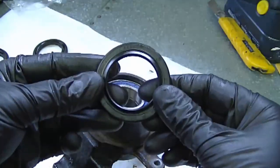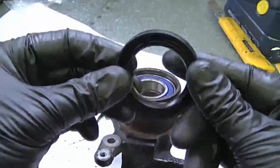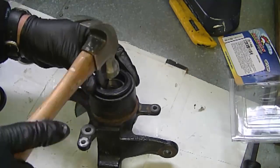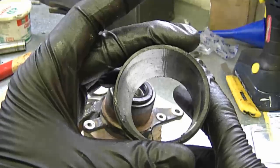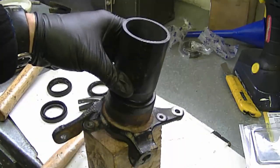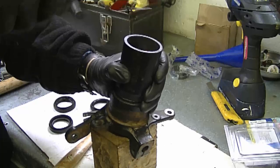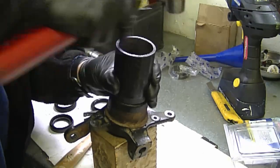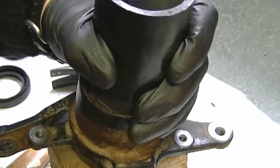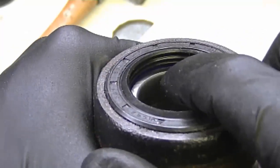I did not do that today because the bearings came out and went in fairly easily. Now I'm going to reinstall the seals — starting with the outer seal, the one that faces the wheel, which is the thinner seal. I'm going to line that up and gently tap all around. I'm also going to use a 2-inch piece of ABS pipe that I've ground down to be smaller, to punch the seal back in. There's a lot less chance of damaging your seal using this piece of pipe. This first seal is now installed — you can see how deep it is and how it meets up with the bearing.